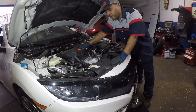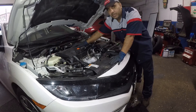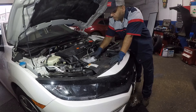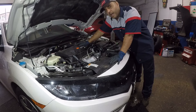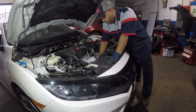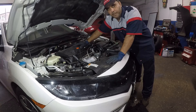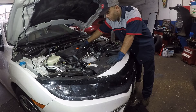Welcome to my channel. In today's video I'm going to be showing you how to remove the oxygen sensor and clean it if you have a 9th or 10th gen Honda Civic. This is the air-to-fuel ratio oxygen sensor. Sometimes these sensors get dirty. There's also another sensor down below. If you have a code for that sensor you can remove it and replace it, or you can simply clean it. Sometimes you'll get a code such as a P0420 catalytic converter code.